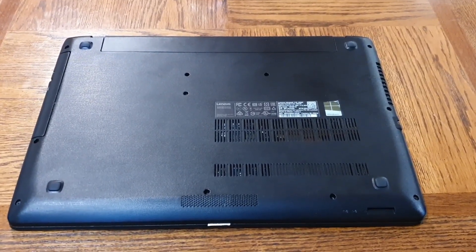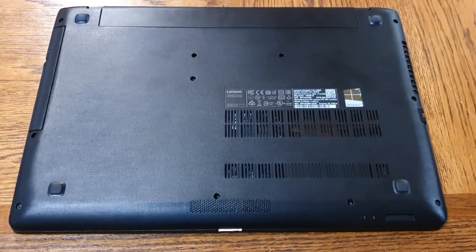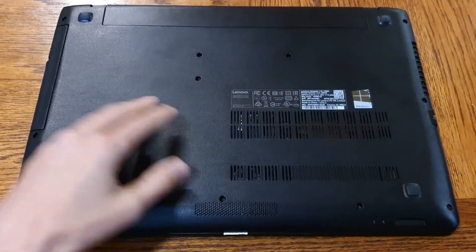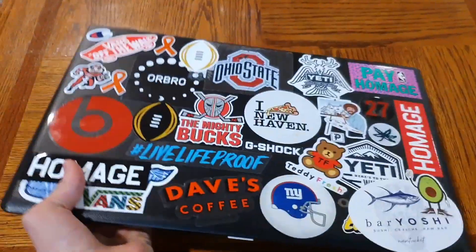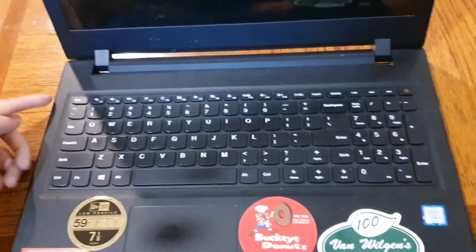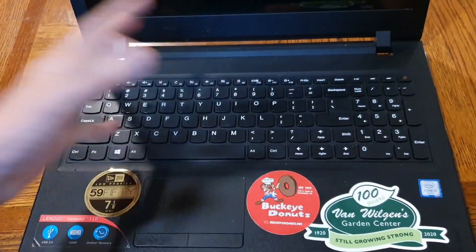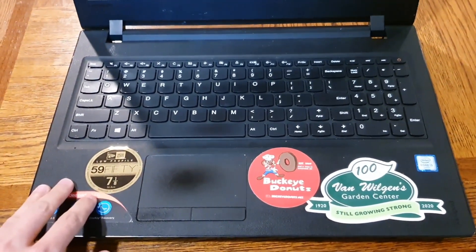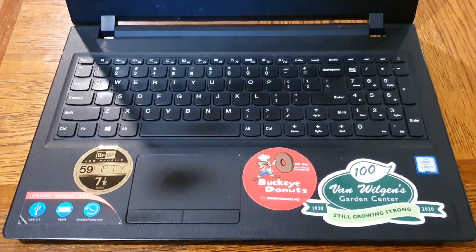Now that we've successfully cloned the hard drive to a solid state drive, our next step is to take this beast apart — and it is not the simplest task in the world. There are lots of screws to remove. We actually have to disassemble the entire optical drive and yank it out, then flip it back over, open it up, get a spudger in around the case, and literally lift the entire keyboard mechanism away from the body of the laptop.